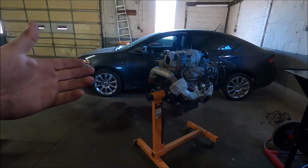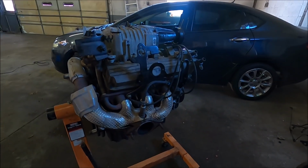In order to even get to the pickup tube. So realistically, for somebody to go through all that trouble to pull the pickup tube off to destroy the engine is kind of weird in my eyes, to be honest. It just doesn't seem right. So I firmly believe that somehow, the bolts of the pickup tube worked their way out and dropped the pickup tube into the oil pan and starved the engine, and kaboom. End of discussion. It took out this original 211,000 mile engine from the GTP.